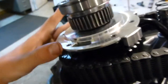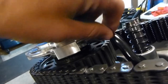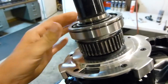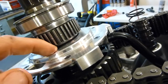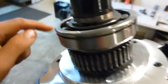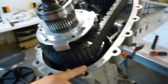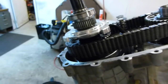To reassemble: take the ring, put it back in, bolt it back up. Make sure your o-ring is seated, get a nice tight seal, make sure your bearing is on in the right direction with the groove up, and there's a lip down on the other side of the gear — make sure that's down. Put your snap ring back in, apply some RTV that Merchant supplied in the kit, put the case back on, snap ring back in, and you're good to go.